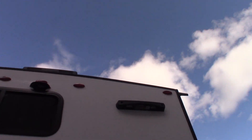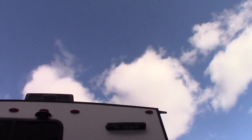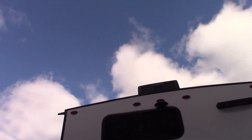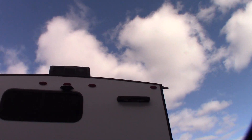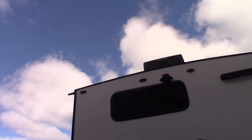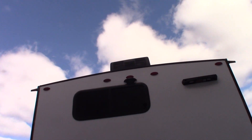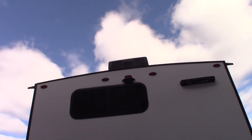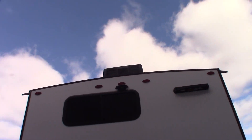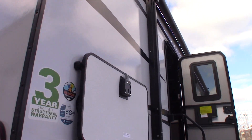This Lippert fitting is a hookup for a telescoping ladder, which is also an option. If you get one of those, you'd have a ladder attached to it, which makes it easy to inspect the roof. The manufacturer says every 90 days you should have somebody go up there and look around — make sure everything's in good shape, no cracking or separation at any of the sealant, no damage to the roofing material from road debris or low branches. That should be part of your regular maintenance.